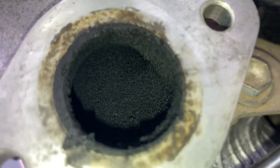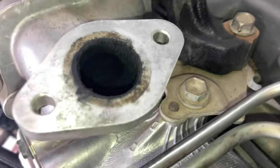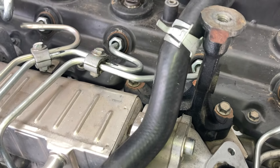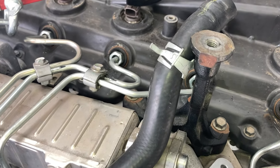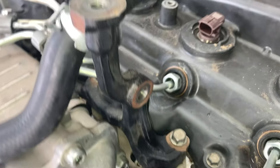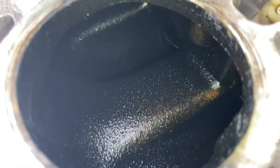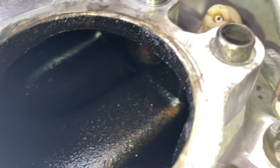This one will look particularly worse because this engine, unfortunately in the 300,000km range, has got a cracked piston. It did have a set of faulty injectors before the recent replacement 20,000ks ago, and we don't know what the history was before that — it's just the way it's been used, a combination of factors. Those old worn injectors probably contributed.